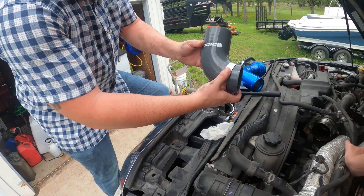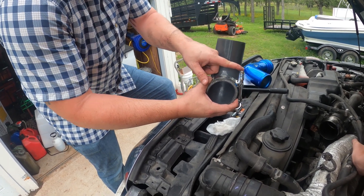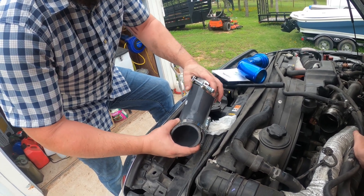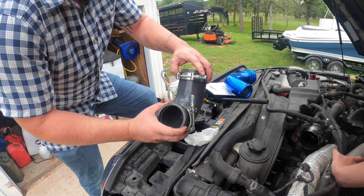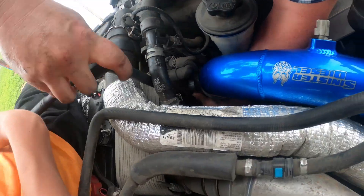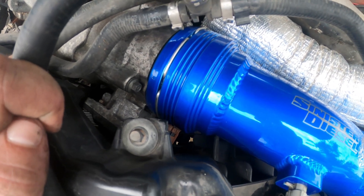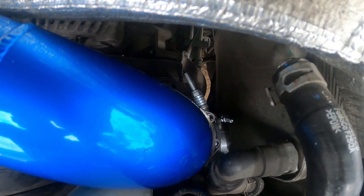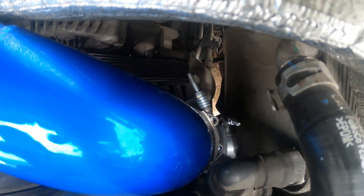You definitely want to make sure these things are nice and tight because there's a lot of pressure and a lot of air that moves through this and you don't want it blowing off. Here we've got the spring clip — this is what holds the top part into the throttle body. Just for reference, this is gonna face the front of the truck. The clamp on the back is gonna make it a little bit easier to hit with a deep socket. Once it's down in there, you'll need a smaller socket to tighten the one that faces sideways toward the engine.